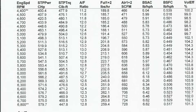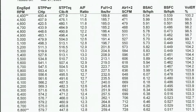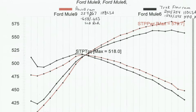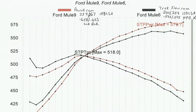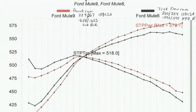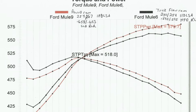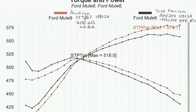I'm going to show you the overlay so you can get a better idea. That little spike you see at the beginning is from the way the dyno was loaded — it didn't settle down before the go button was pressed, so it skews the numbers. The black line is the Trick Flow cam and the red is the Powell cam. The Trick Flow is better to about 5,100 RPM, then the Powell takes over. On averages, the Powell cam is better on both horsepower and torque — even with that spike making the Trick Flow look better.